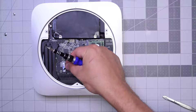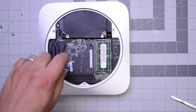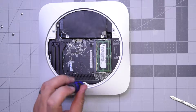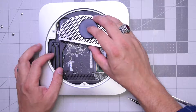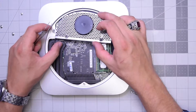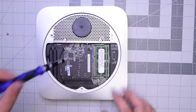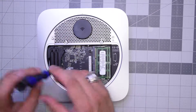That seventh connection is the fan. Go ahead and pop in the screw securing the logic board. Then align the Wi-Fi antenna in the correct orientation, put its cable over the Wi-Fi card clip, and pop it into place — make sure it's nice and tight and locked. Secure the bottom two T-screws first, then the two T-screws on the right and left.